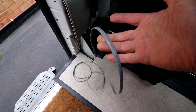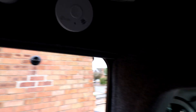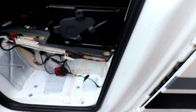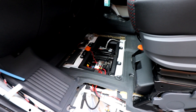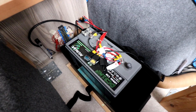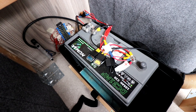This is the link cable for the interface which is just there. I'm going to remove the smoke alarm and put the interface there a bit later. The cables then come through underneath here, underneath there, down along, and then across to the battery. I still need to fit the fuse for the solar controller at that end and am just now starting to sort out the other end for the leisure battery. The leisure battery end is now wired up. The only thing left to do there is put the fuse into the fuse holder once everything else is connected.